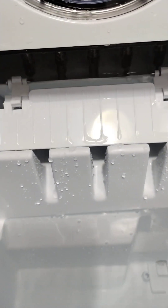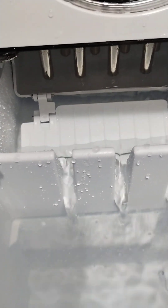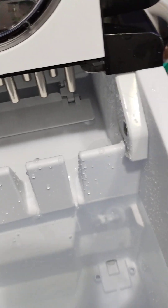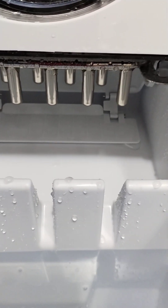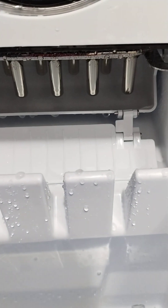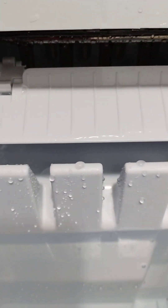When it stops trickling water, turn it off — that's your first cycle of your cleaning mode, I guess you'd call it. You're gonna repeat this process, keep turning the power button off and on. I like to do it 10 times; you can do it 15 or 20 times. For the sake of the video we're gonna speed this along. You're gonna drain your solution.